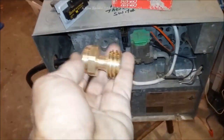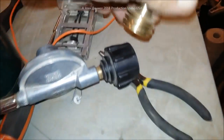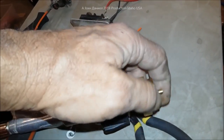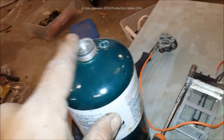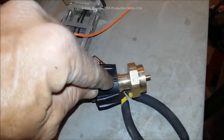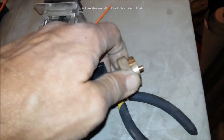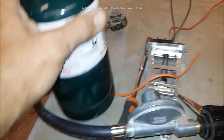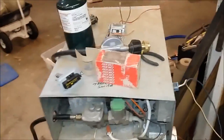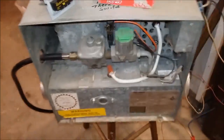Now in this one's case we're going to hook it up. You've probably seen in my videos these little adapters that go on a small propane can and hook right into a standard regulator. You can find links at the bottom of my video. Screw it in, make sure it's completely tight, then screw the bottle in. Do not remove it while the bottle is attached because it's a straight shot through. These are only about ten bucks and they're awesome — if you get in an emergency situation you can have a bottle or two underneath your couch in your RV to keep your refrigerator or heating unit going. I keep about five of those bottles in my RV.